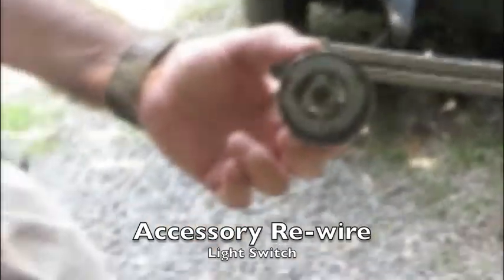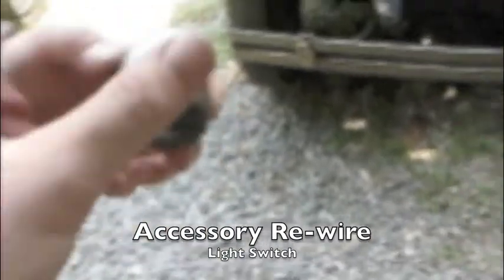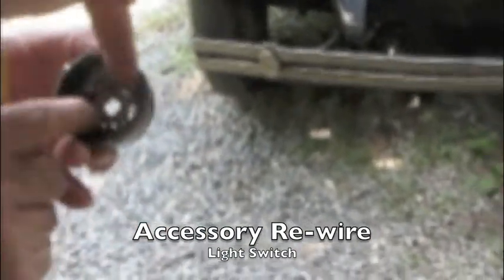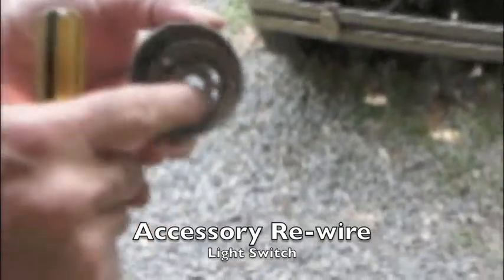Alright, so this is the top light switch cover. The stem from the steering column comes down, it sticks into that. The horn contact is there. The little two teeth, the spider, the two teeth go into either side of that. And there's a plate with the nubs on it, and a plate on the nub on this. So this is the spider, and a spring that holds the whole thing tight. Right. And then the other plate goes on the other side, makes the contact, and makes all the adjustments. So we'll show that going in here in a minute.